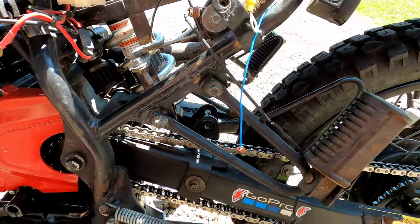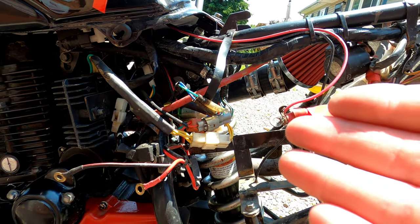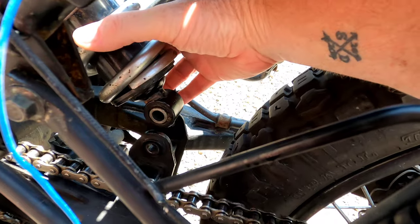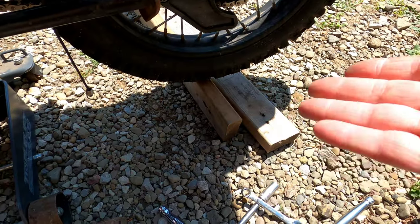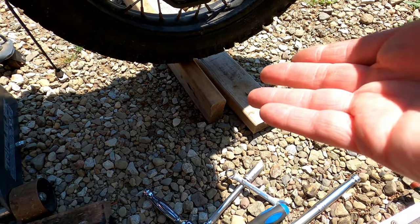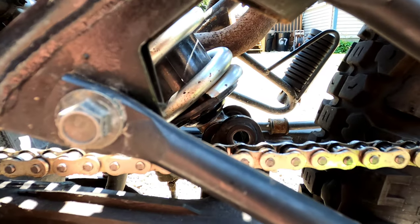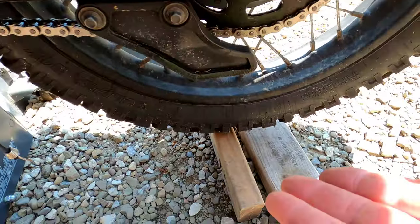This is where you're going to have to play around with the jack a little bit. I got the shock bolted in there — the grease helped get it in there. It's almost the exact same fit as pulling the other one out, so that went right back in there. I have it finger tight right now; I don't want to tighten it down all the way yet. Because this shock is shorter, we're going to have to lower the bike down just a little bit until we can get it close enough to run the bolt through. The rear tire and swing arm really aren't that heavy — you can lift them with one hand. I used a 2x4 sideways, and that got the holes pretty well lined up. It gave me enough room to work it into the hole — grease it up and stick it in. That was actually really easy. The 2x4 trick worked pretty good on my DLX.